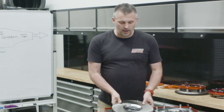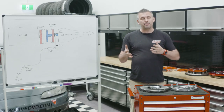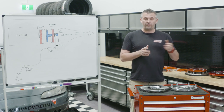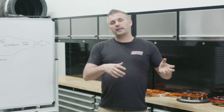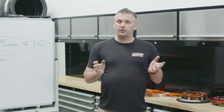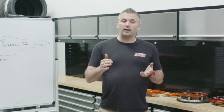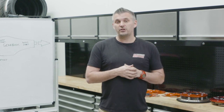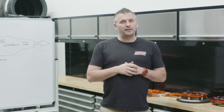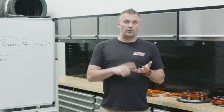The other thing to look at with flywheel design is if you get rid of the dual mass part of a flywheel by making it lighter — cars that have a dual mass flywheel have that to quieten down or dampen the vibrations and noise in a drivetrain. An R34 GTR is a perfect example. When you have a factory clutch with a dual mass flywheel from factory, the drivetrain is really quiet. But when you take out the dual mass flywheel and put in a conventional one-piece flywheel, no matter how well it's balanced, the drivetrain in an R34 gets really noisy. Even when you're idling in neutral, you can actually hear the clatter of the drivetrain inside the gearbox. Most people freak out and think there's something wrong with their car, but there's not — you've gotten rid of the dual mass flywheel, all the dampening's gone. Put your foot on the clutch, noise goes away.